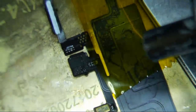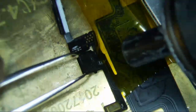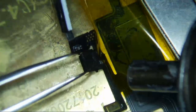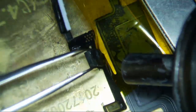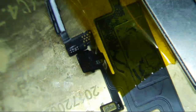I like to do the back of it. So basically, if you can see, the flood illuminator is on this side — I just like to heat the back of it at very low airflow. And then as soon as it melts — 250 degrees Celsius with airflow of 15 — it's just gonna pop right off. I don't put any flux on it because I feel like sometimes the flux... it just pops right off. See that? No problemo. Because sometimes I put flux on it and it doesn't work. I don't know if that's just coincidence or what, but I just don't flux it.